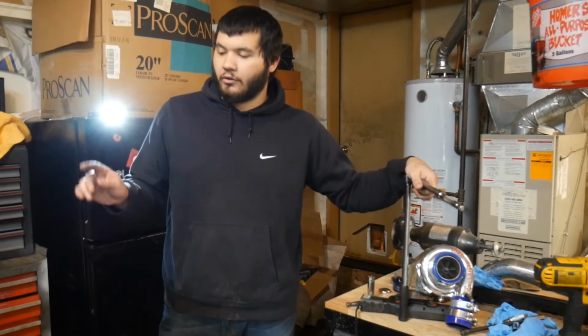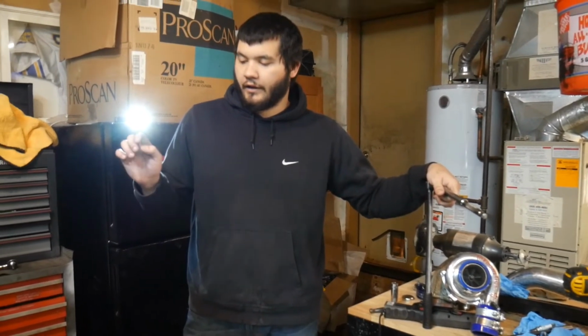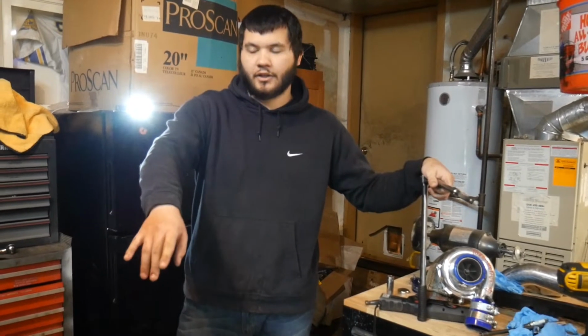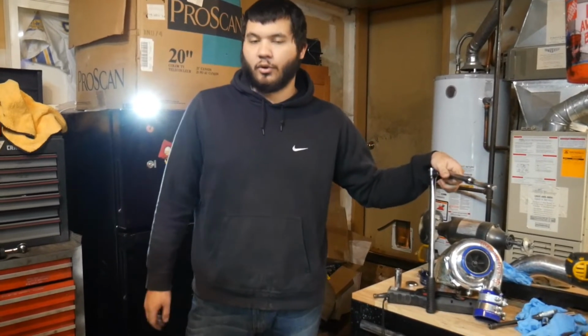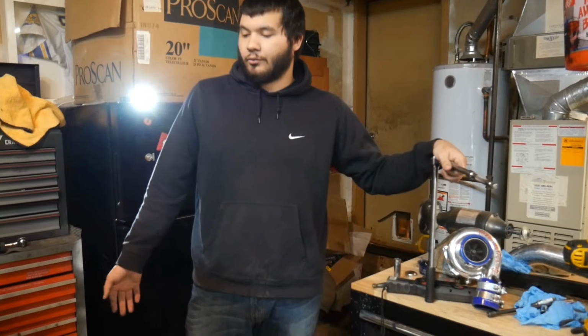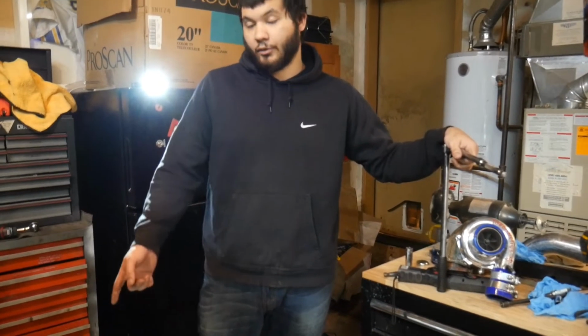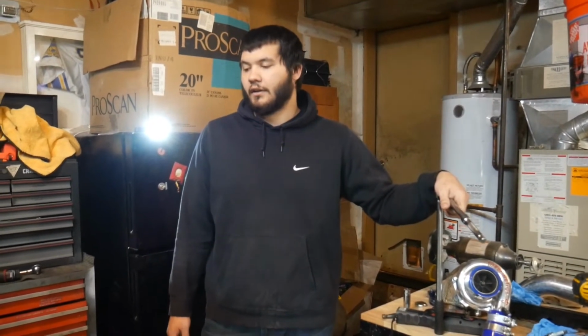And then from there we're going to mark it, and we can take off the cooling lines that I left on there, and we should be able to pull the head. After that, we'll see what's wrong with the engine. The bolt being finger tight on the crank pulley is probably part of it. It's at least related, I assume.